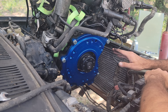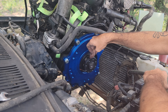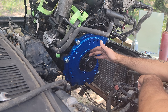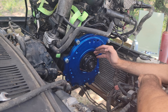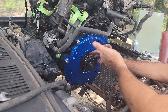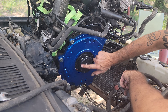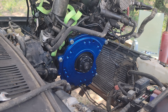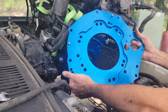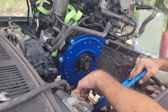This is the adapter that goes from Volkswagen to the flywheel of your choice. Mine is going into a 92 4Runner, so I got a flywheel for a 3.4 because it's a little bigger and heavier duty, and it has this bolt pattern right here. The other part is the plate that goes against your transmission.